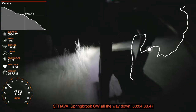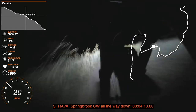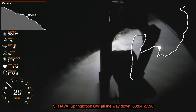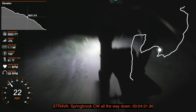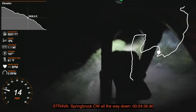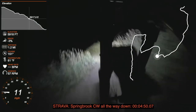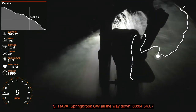The high-speed doesn't appear to be affected — there's no high-speed compression or high-speed rebound control on the Fit4 fork, and I think this is one of the issues I have with my fork at the moment. It's not horrible, but it's not great either. The fork is pretty decent for the most part, but it could be better. I'm now considering replacing the entire damper assembly with a Grip 2 to give me both high- and low-speed compression and rebound damping control, and I think that will allow me to get the fork the best that I can out of it.